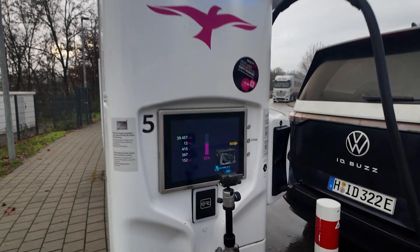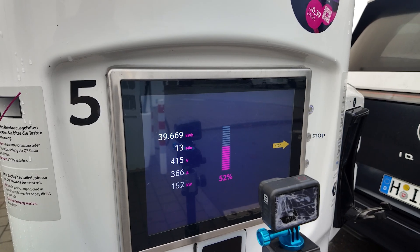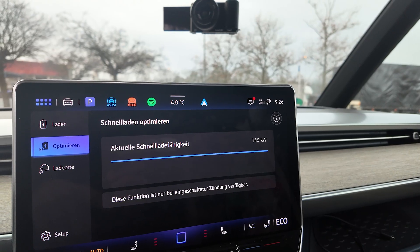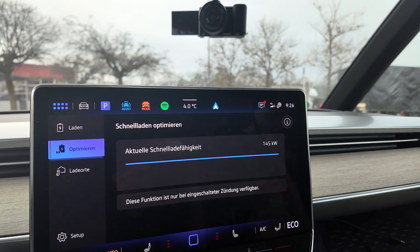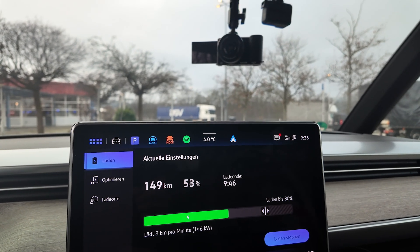I've done my first range test with 130 km/h. It took only one and a half hours — I only drove 201 kilometers and arrived with 12%, so the range was 228 kilometers with this gigantic 86 kilowatt-hour battery. But it charges pretty nicely. Till about 38% I still got over 200 kilowatt, and now at 52% I'm still getting 152 kilowatt. When I arrived with 8%, it said 130 kilowatt, so that estimate was totally wrong. It thinks 20 minutes to 80% — I really doubt that.